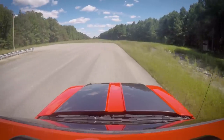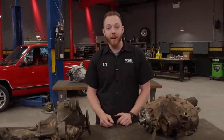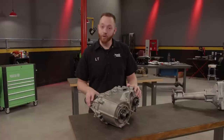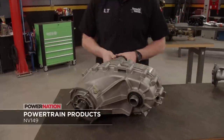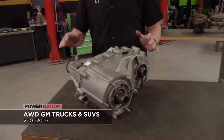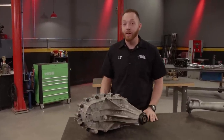That's fine if all you want to do is go drag racing, but we want to build something a little bit different. If you know the Silverado SS made between 2003 and 2006, it was a full-time all-wheel drive truck. It used a special transfer case with a viscous coupling inside that split power 62% to the rear and 38% to the front. We just found one — an NV149 transfer case from Powertrain Products, remanufactured with a new chain, bearings, and seals. It'll work perfectly to convert our old Chevy into a full-time all-wheel drive traction machine.